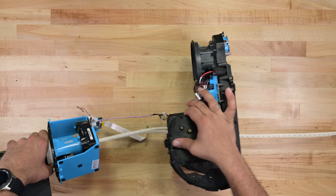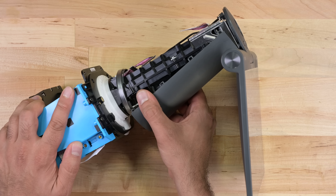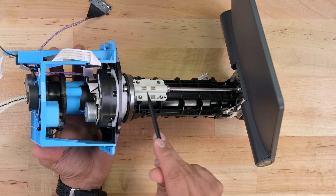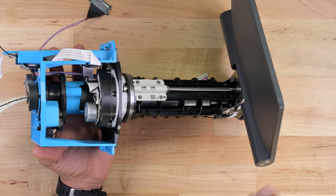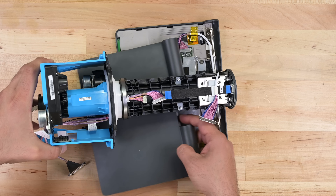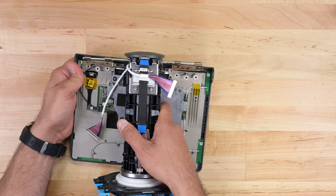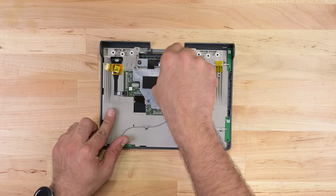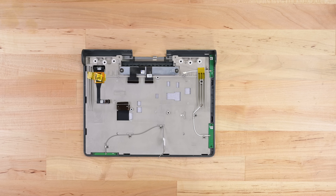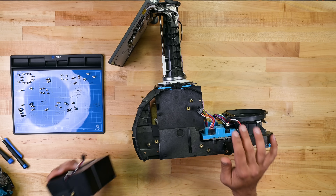It's time to Marie Antoinette this robot and separate its head from its shoulders. The victim is unceremoniously dragged onto the teardown table for further experimentation. And we arrive at brushless motor number five. This one is responsible for tilting the screen up and down, which together with the neck motor, helps Astro mimic the kind of movements we'd expect from intelligent life. Let's take a peek under Astro's face — no sign of glue, that's a positive. Just a few clips that come away easily enough. An antenna here, a few flex cables there, and some screws securing the hinge is all it takes to separate the screen from the neck and periscope housing. Taking the heatsink off this board reveals even more thermal paste. I'll need to remove some cables and antennas to get the board out, and just look at all this goop. Nothing wrong with it, it's not glue, but it's surprising to see how much heat management these boards need. And with that, our teardown is complete.